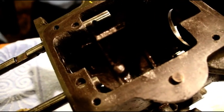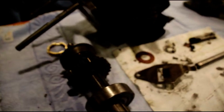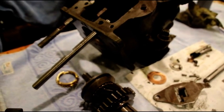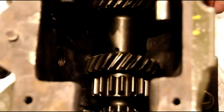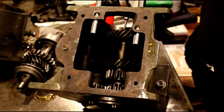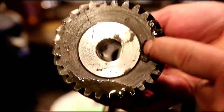I'm going to get to washing this out and putting it back together. Just wanted to show you what can happen when you use the wrong lubricants. If anybody's interested in the lubricants I sell, you can contact me directly. Okay guys, I'm going to give you a few critical tips for a T84 rebuild. We've got a new cluster gear in there with bushings and spacer, and that has been reamed — don't try to get your counter shaft through there without reaming it first. We're replacing this — it's a new one I put in less than a thousand miles ago and we've already got a damaged tooth.